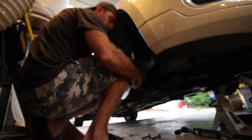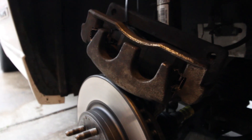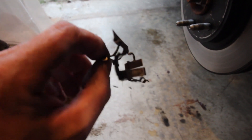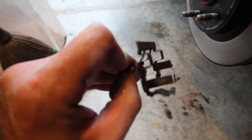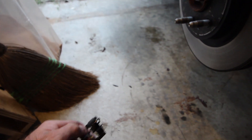I'm going to hang them up here with a hanger — I use zip ties. You can see I've used zip ties to tie it down here. Everything on this brake job is pretty straightforward except these little retainer clips. I don't know what they call them. Every OEM brake caliper has something like this — these are the most complex I've ever seen. I can't even imagine what the forming die looks like to stamp these things. These parts are the springs that essentially push the pad toward the rotor.